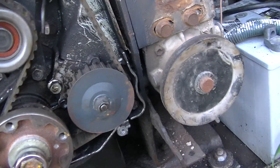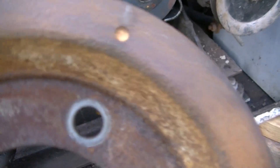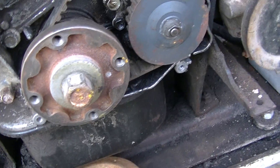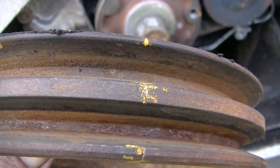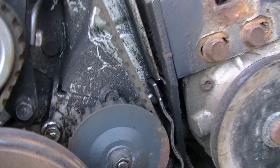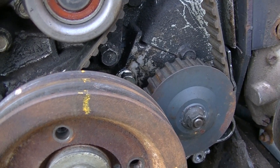Now there are three marks on this pulley. I found this one here with the yellow stick; there's one on the front with a dot that serves no certain purpose — just ignore the dot. I'll take the wrench off. You'll see there's an offset between that yellow mark and a cut line in the pulley itself. If you put this in this position, the slash mark on that pulley will line up with the index for the timing on the front cover.